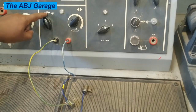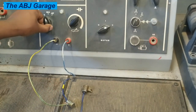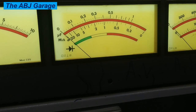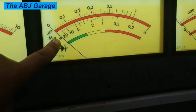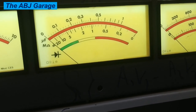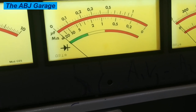All we have to do is turn this to the megaohm position so that we can read the resistance of the capacitor. That will tell us if there is an internal short or not. Turning it to the megaohm position — see what happens when the capacitor is first switched to the resistance setting. It jumps to some resistance value, and then as the capacitor gets charged it will go to the infinity position. The resistance value is now at infinity, which indicates the capacitor is in very good condition — there is no internal short. That is what happens when a normally operating capacitor gets fully charged; the internal resistance should read infinity. Even if you test this with a multimeter, it will read some resistance value initially, and then as you charge the capacitor it will keep increasing and finally should read infinity.